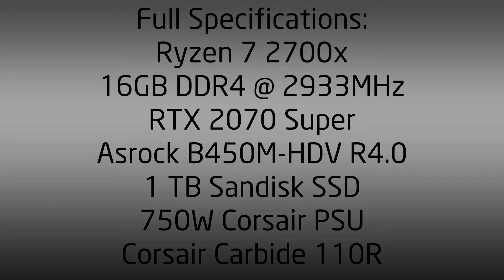I'm then going to compare the CPU temperatures in each scenario and decide whether or not it's worth having the fans given what they cost. Here are the full specs of the machine I'm going to be running these tests on. As you can see, these components are likely to be generating quite a bit of heat. The 2700X is equipped with its stock cooler, and the RTX 2070 Super is overclocked to +100MHz on the core and +500MHz on the memory. The CPU is not overclocked at all.